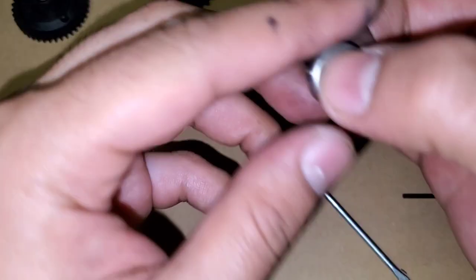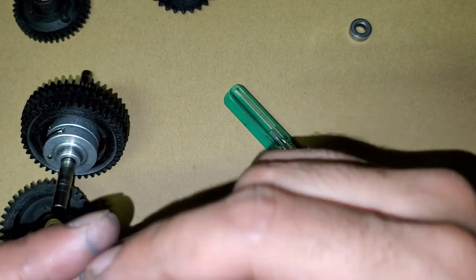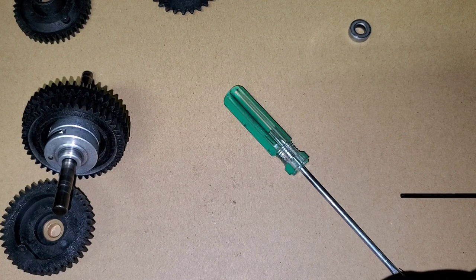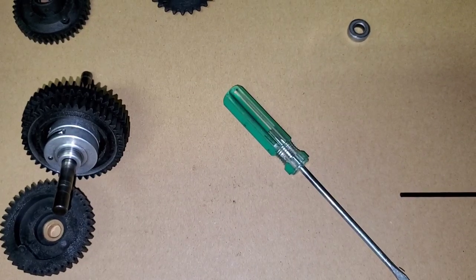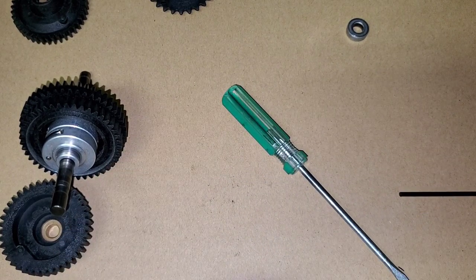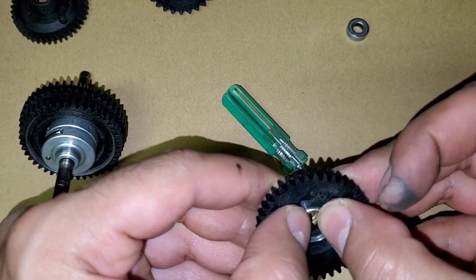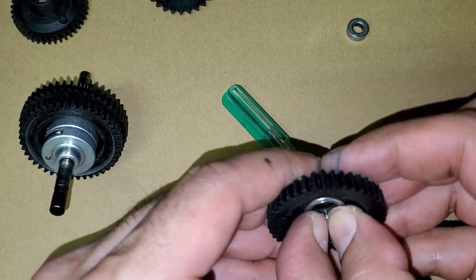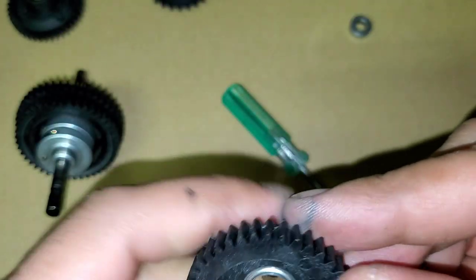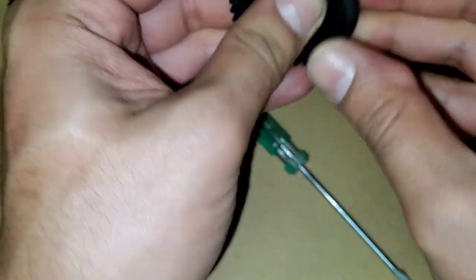The bearing is operating very smoothly. Just making sure it's clean — there's a little particle in there, let me get that out. Now we've got our new third speed gear. Take that bearing and place it right in there — it should just slide in. Make sure you put it in evenly and press on it evenly. Just use your hands — you don't need any tools, and using tools risks damaging the bearing.